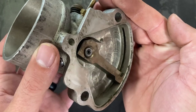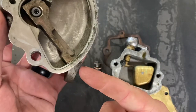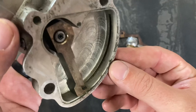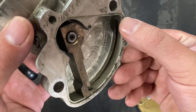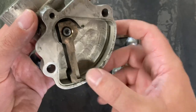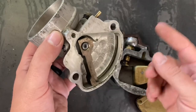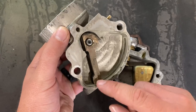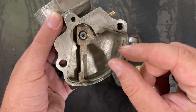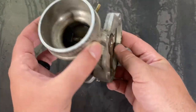On the bottom of that casting there's a groove that follows the 45-degree travel of that arm as it actuates with the throttle plate. This arm has a hole directly beneath it that is in line with this groove. The groove actually becomes deeper as it travels up the casting — that is what meters your fuel. All the way to the left means very little fuel; all the way to the right allows as much fuel as that void will pass. In idle we're all the way to the left at the shallowest point of that groove.